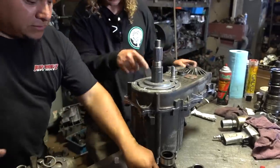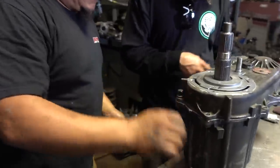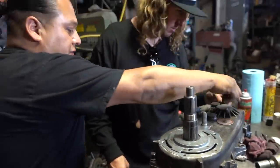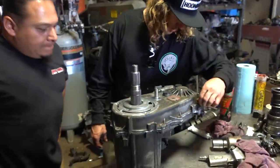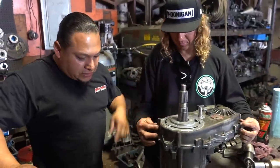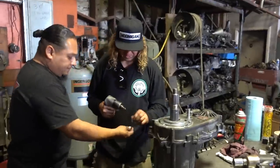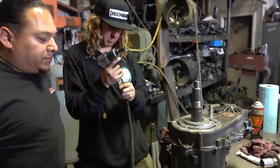Cool, so you can pop the main ones in. Snap ring again, correct? Yeah, I'll show you this. These are the main ones here. It's got two main ones, the long ones with the washer. The dowels are in the corner. Here you go. I like to secure these first, just to be on the safe side, while you're doing the rest. So now you just barely run them home with this, correct? Yeah, just barely run them in there and ready to rock and roll.